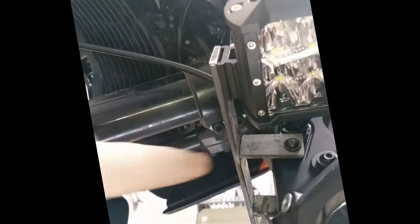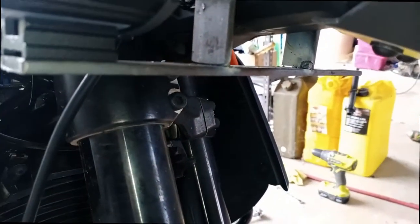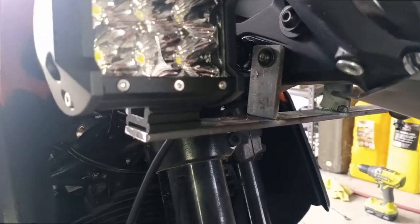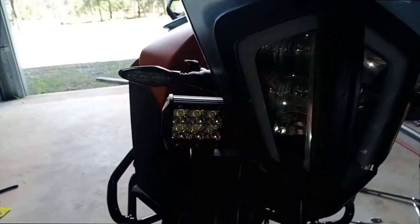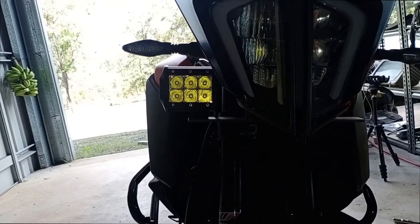I just need to work out how long a piece I need, then weld and paint it up. I've got it sitting on there for the moment. That was the 50mm bracket. Then I've done up this bracket here — in between these two pieces is 87mm, and I've kicked them out 170mm after that. Taking into account 5mm thickness of both sides, plus 10mm, so I got to 285mm — plus or minus 5mm given my accuracy. Not too intrusive, and it does pop down a little bit.